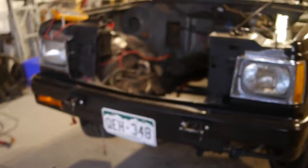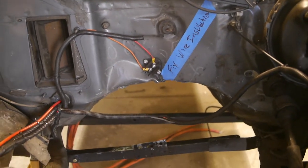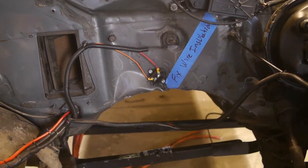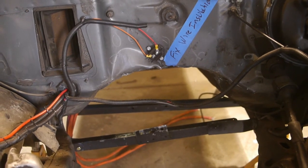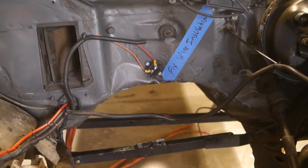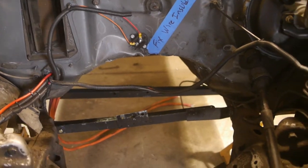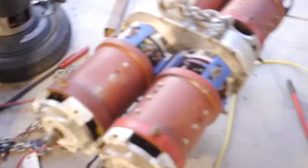Also wanted to show the tunnel widening I've done. I actually had to cut a seam there, and when I jacked up at those points it gave room for the metal to stretch and grow. That relieved it and gave plenty of room — relatively — for these giant motors. I ended up nicking a few wires on the insulation just trying to cut through the sheet metal, which is why that blue tape is there. Anyway, we'll try to get the quad motors installed.